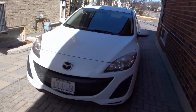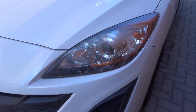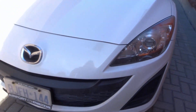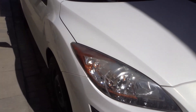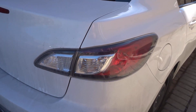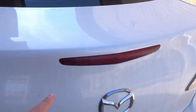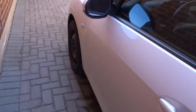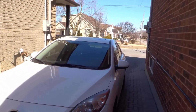The next thing is to look at all of the lights. Make sure they don't have any cracks, and make sure they work. Bring a friend along or ask the owner to turn on the lights, signals, tail lights, and reverse lights to confirm they're all functioning properly. Don't miss any lights — check the trunk light, spoiler light, and side markers too. Getting all of the lights will really help your assessment.